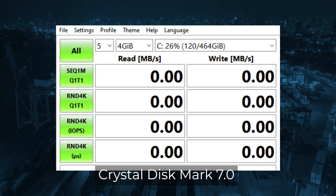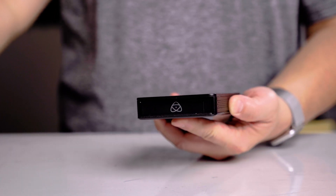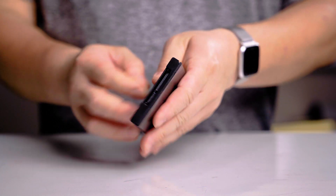We evaluate drives using three different tests. Crystal Disk Mark gives us an overall snapshot of performance — read and write speeds in megabytes per second. The AJA system test gives us a good idea of performance in 4K video production workflows, including minimum read and write speeds and any variations. Finally, a drag-and-drop test sees how quickly the drive writes a large 49GB file. All tests are performed using a GTech Atomos CADdy reader on a USB 3.0 interface, with all drives installed in compatible cases.